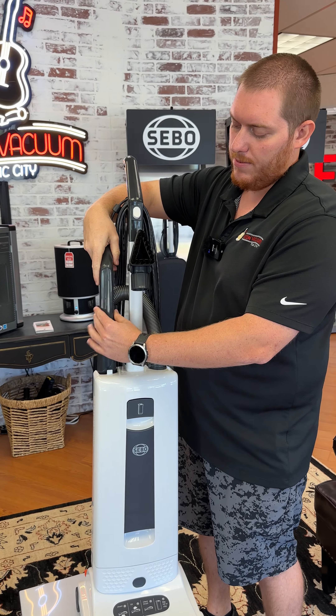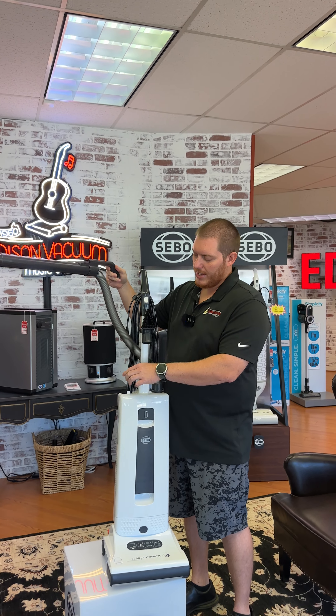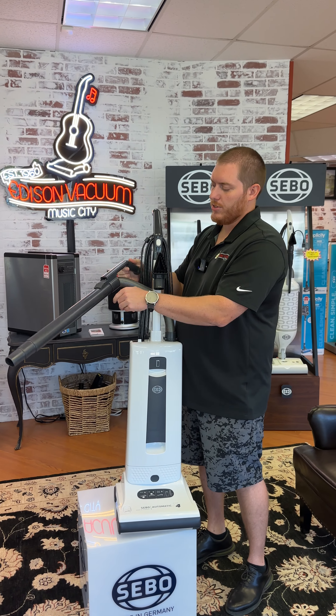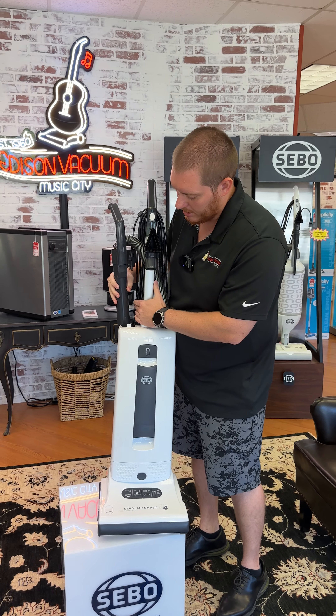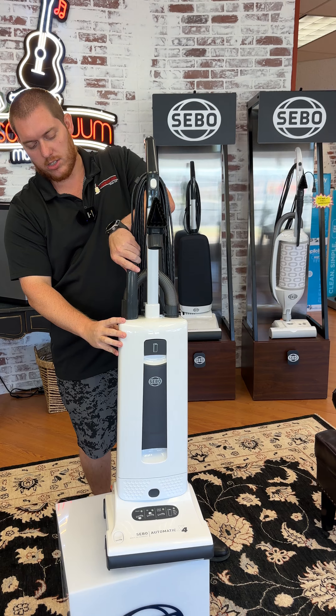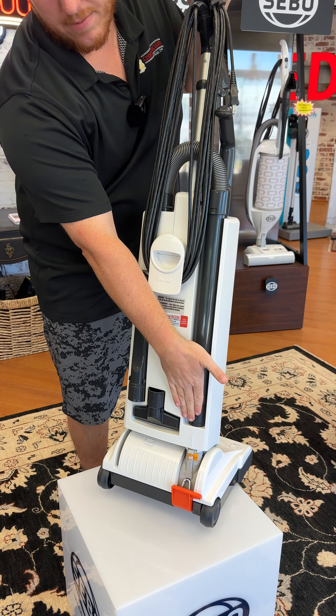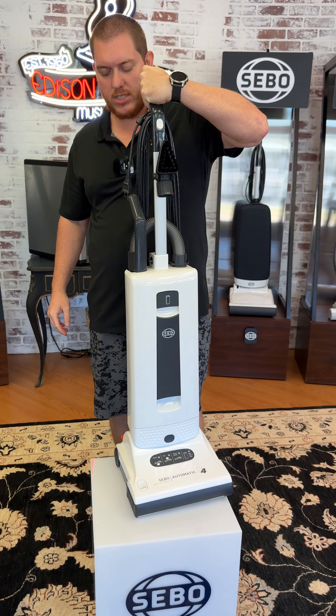It does have one built in on it. This right here is for your deep cleaning, trying to get higher or lower. They do make nine-foot extenders which you can attach to this machine for more of a deep clean or if you're trying to get higher or lower. When you put this back in, you want to make sure you get it locked all the way down at the bottom so you don't lose any suction when you get back to using your head. Make sure it is locked all the way down right there.